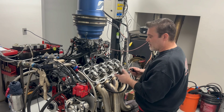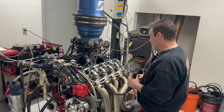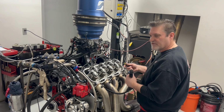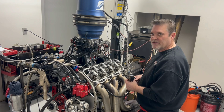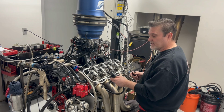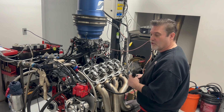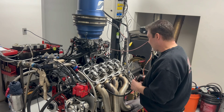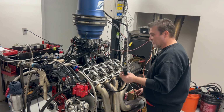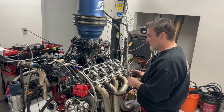So we're going to write those numbers down on our valve cover, and as we're racing the motor and changing our plugs, adjusting our valves, this might be a check that we do to check the wellness of this engine. Like I said, if these numbers start going down, the motor's wearing out, or you may have burned a piston or something. On nitrous engines, it's real critical because it's real easy to burn a piston if you're not careful when you're spraying nitrous.